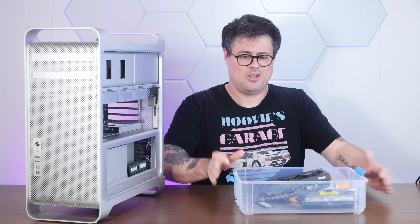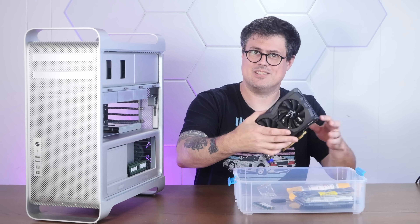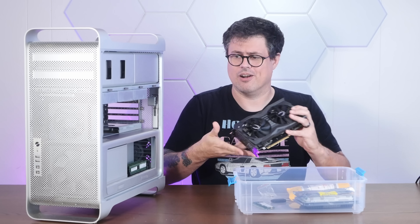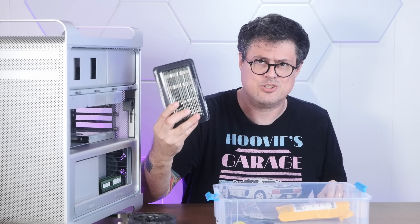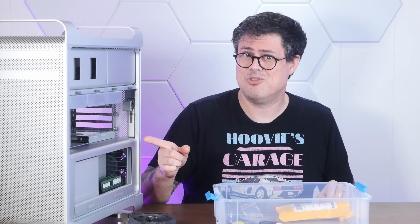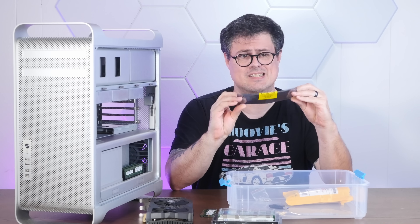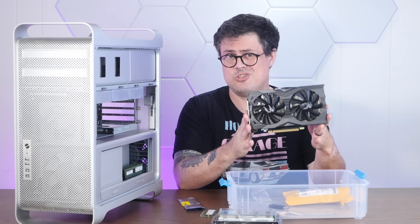We're going to be doing a lot of mods to this thing today, so buckle up. Last time we had this 2070 working off of a janky external power supply — that was really just a test to make sure it would work. We're going to do it a little bit better this time. We're going to upgrade the RAM to 128 gigabytes, get this thing booting from NVMe, and we're swapping out the dual X5550 Xeons for dual X5690s — that's six-core 3.46 GHz in each one — and we're going to try to power this thing in a less stupid way.